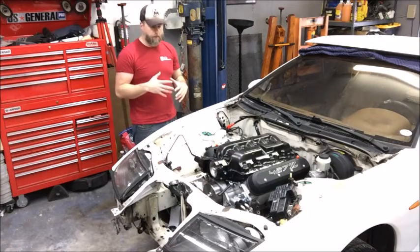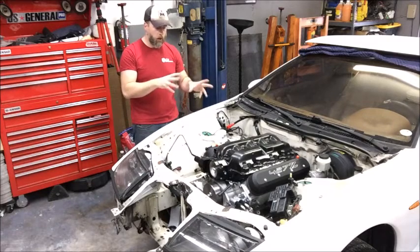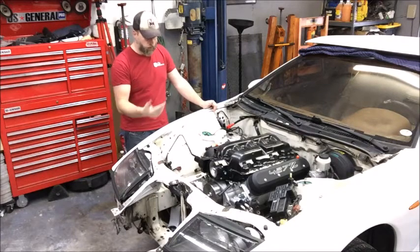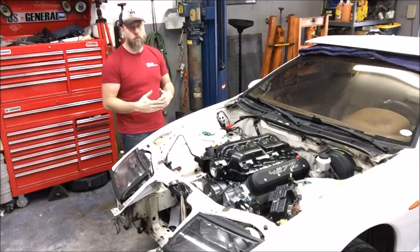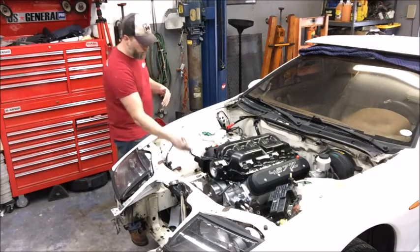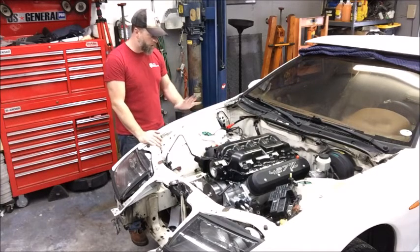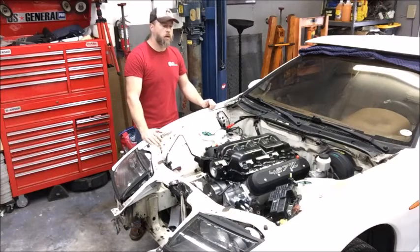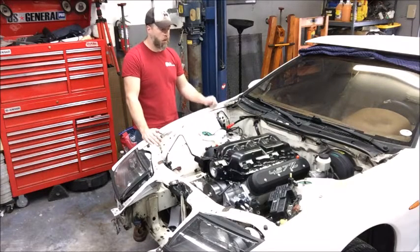The only other work going on right now is the ignition system. Because this car has custom valve covers — powder coated and etched by LOJ — they require the relocation of the coil packs. The coil packs need to be relocated somewhere else in the engine bay, and a 300ZX is pretty tight width-wise. There isn't a lot of room down low on the frame rails because of the alternator on one side and the AC compressor on the other. This car is retaining factory AC. Some ideas we had were mounting the coils under the battery tray on one side and under the clutch master cylinder on the other, or mounting them up under the wheel well where the factory air injection valves were located. That last option I want to steer away from simply because from a maintenance perspective it's a lot harder to access down there.